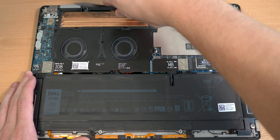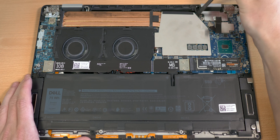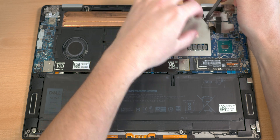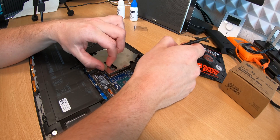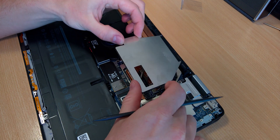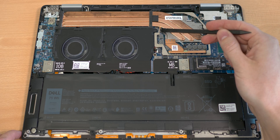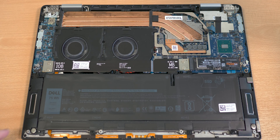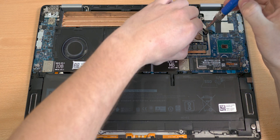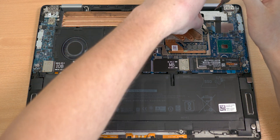First there's an aluminum plate on my device, which can vary between devices — Dell loves to keep an additional aluminum plate on there. After removing this, the next step is unscrewing the complete heatsink and heat pipe mechanism. Now I have it open and these are all the screws I need to unscrew to remove the complete cooling mechanism, all the fins and heat pipes, to get to the die and the thermal compound we want to replace with liquid metal.